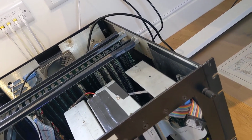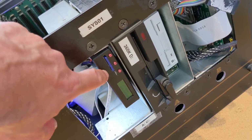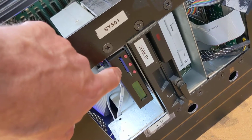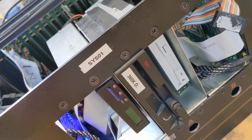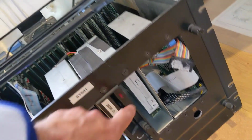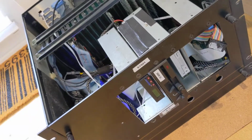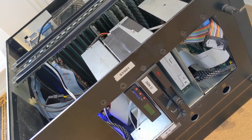And the other really cool factor on this computer is that this is the HxC floppy emulator. Now this is a very clever product which can emulate 2 floppy drives, and you can see I've got the A drive and the C drive are on here. And for legacy and moving data around, I've got the B drive and the D drive here. This is a very clever drive. This is a B drive, 3.5-inch drive, which Cromemco never had, but we've been able to, by changing some of the circuitry, make that look like an 8-inch drive.